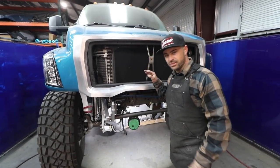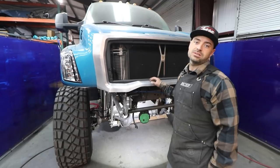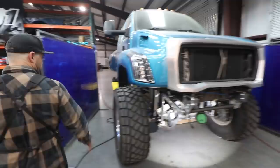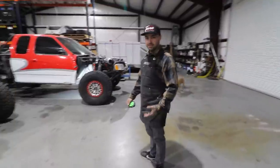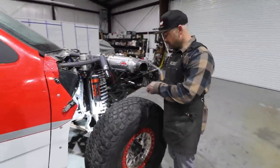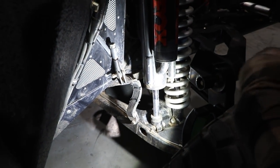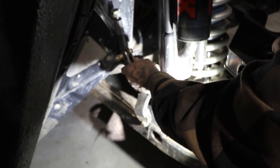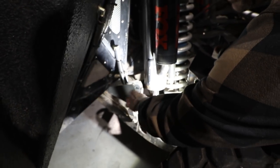If you guys want us to do a built to destroy on this, we have no problem doing that. It's going to go out testing soon — we're going to take it to Dumont, Glamis, and even the desert. This is the Proctor pre-runner for the Honda team, a 97 F-150. This is a center mount truck, same situation. The straps are in a very similar place to James' setup on his lower arm. You can see the big tab here in line — this is an adjustable clevis. If you want to cinch these up, you can. This is a double limit strap, zip-tied just to keep them together.